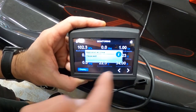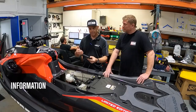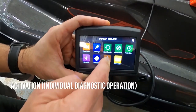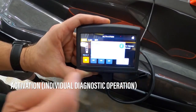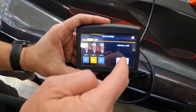The next item is 'Information,' which gives you the serial number of the unit, the engine identification, total running hours, and other information pertaining to the actual vehicle you're working on. After that is 'Activation,' which is really cool. From this screen you can actually activate fuel injectors, coils, and the IBR engine to see if different things are functioning properly.